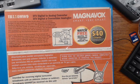And digital TV now, unlike analog TV used to be, with analog TV you could get weak signals. And it'd be a lot of snow and fuzz, but you could still get it. You could still see what was going on. You could hear the audio. When they went to digital, it was like you either get the signal or you don't. Or you get a picture for a second and it's gone. So it's not snowy or fuzzy, it might be pixelated, but it's either there or it's not there, basically.